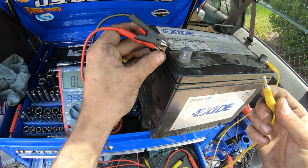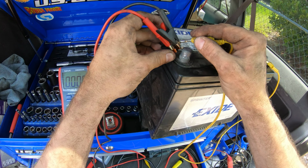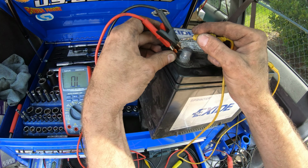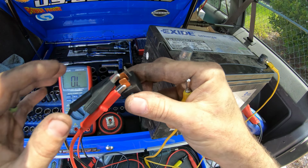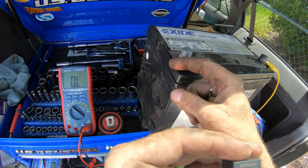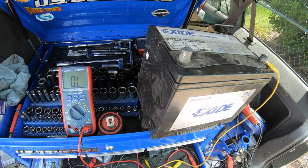So we'll watch the multimeter again. Okay, it's open right now, closed, open, closed, open. So just needs a relay. So we're gonna pop in this Mitsuba relay and put in 2 fans, which is a different problem.